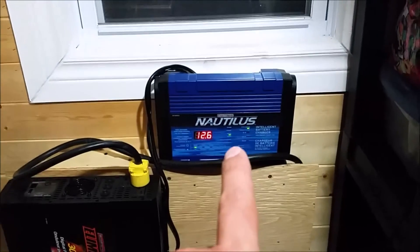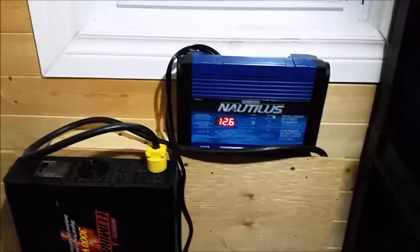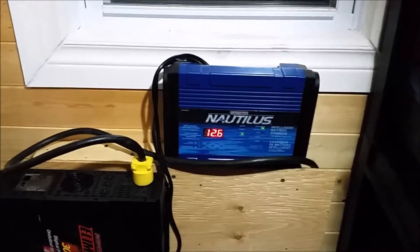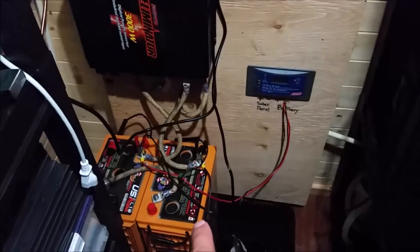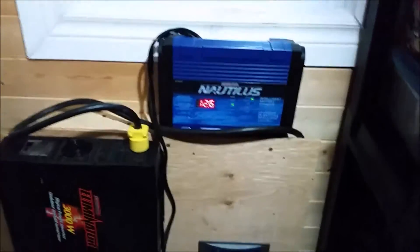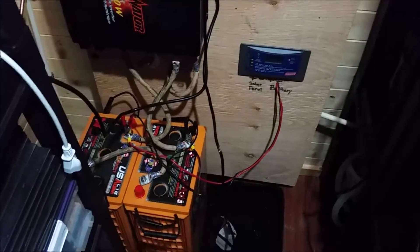I'm using an intelligent battery charger — I've got an AGM trickle charge, which is only a little over 1 amp, about 1,100 milliamps. I'm going to use this until it gets up to 13 volts, because the key with the glass mat batteries is they don't like higher voltage. What'll happen is the sulfate plates will get too hot and cause evaporation. And where they're sealed, without proper instrumentation you've got no way of knowing how much distilled water to top them up with.